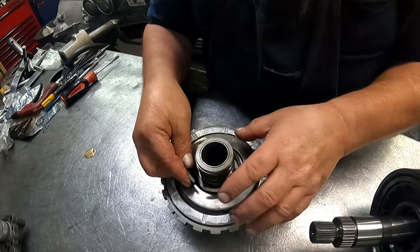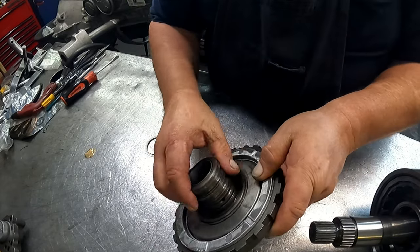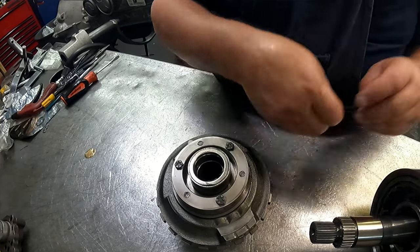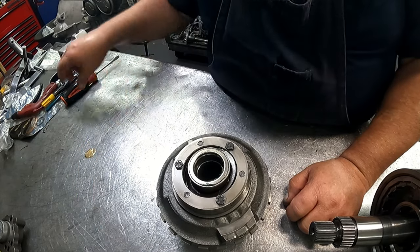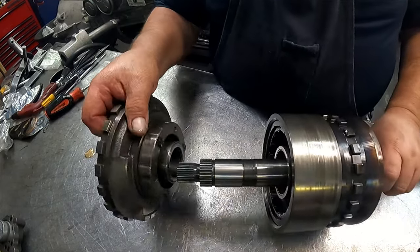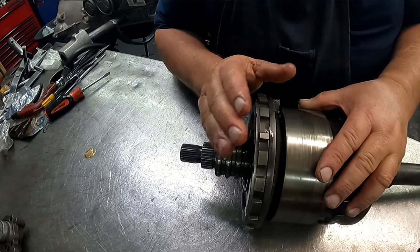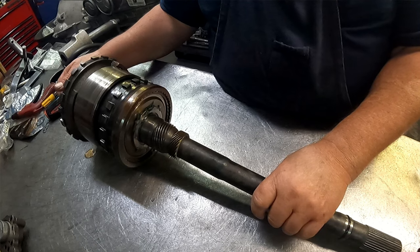And we have our snap ring, short end of the taper up again. Four sealing rings are hook and loop like the others. Our race lip goes in. Washer here, could be fiber, could be plastic, could be metal. This goes on top. And when it's in there, the support's going to be turning counterclockwise and locking clockwise. And there's our setup for the early style.